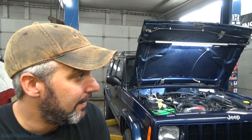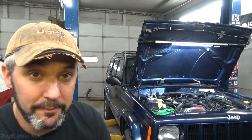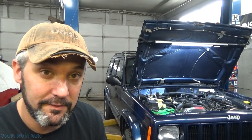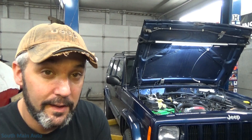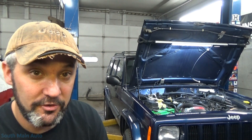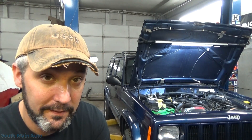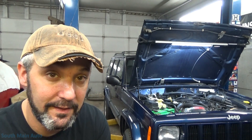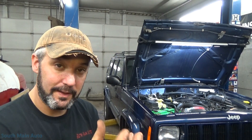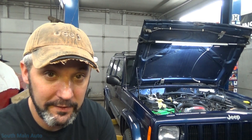What I've done so far is look at the vehicle and duplicate the symptoms. Being that the crank sensor is the key player in saying it's misfiring, I looked at cam and crank synchronization — which is dead on the money. I have some known goods for these vehicles and compared it to that. Cam crank is perfect. I checked the cam crank sync, which is the relationship of the cam sensor synchronization to the crankshaft, and it's within two degrees. So that's perfect.